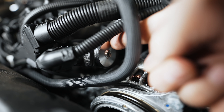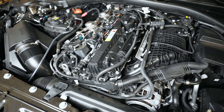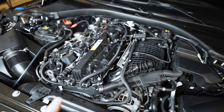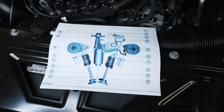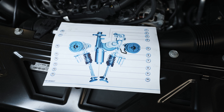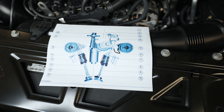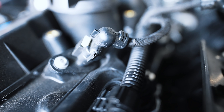Starting right here, we have an electrical connector — inside there's an electric motor which bolts to the cylinder head, located where the intake cam would be. That's part of the Valvetronic system. That electric motor spins a gear which adjusts how much intake lift there is for the valve, so you don't need a throttle body and the obstruction from it.